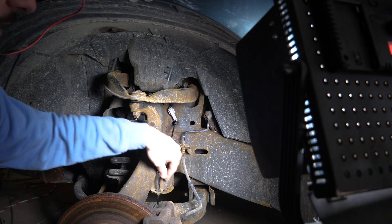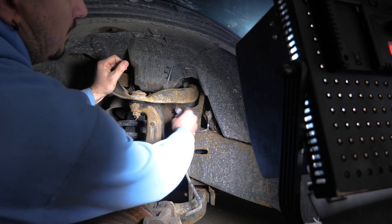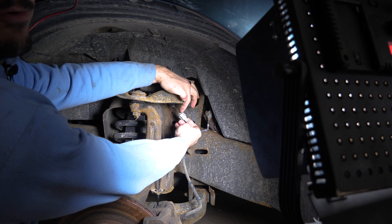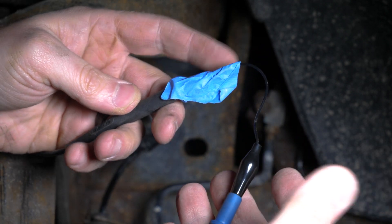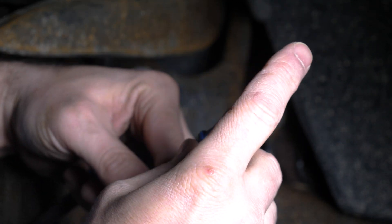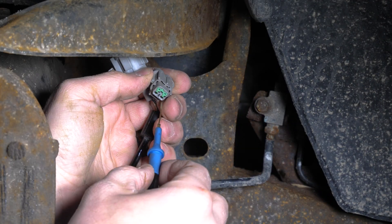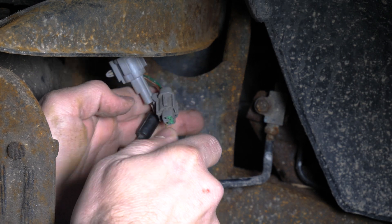To accomplish this, we want to follow back our sensor cable and it goes up to this little connector here. This will pop off of your frame there and then you just want to disconnect it by clicking this little connector, pushing down and pulling out. I fashioned up this probe from my multimeter with a little alligator clip going into a tiny little probe that I'm going to slide into that connector.